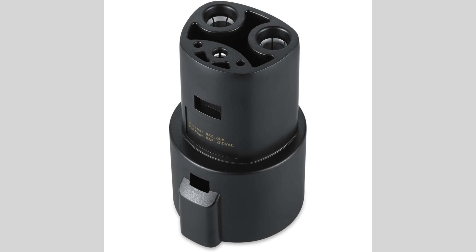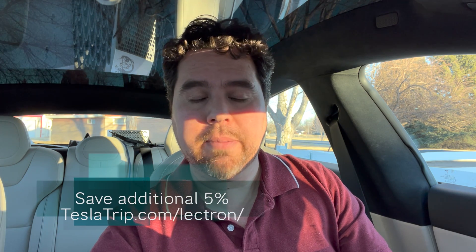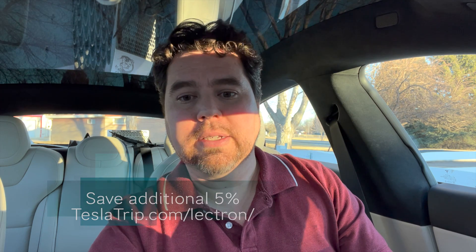It's virtually identical to the Tesla one. They've also got a lot of other adapters. If you've seen my CCS charger adapter, this will work on Teslas that are not upgraded to CCS compatibility yet, so it'll work on older Teslas. There's going to be an official adapter from Tesla, but it's not out yet in the United States, and even when it is, you have to have the hardware that supports it, which is only the newer vehicles. It's definitely a great option — it's double the speed of the CHAdeMO charger in my case.